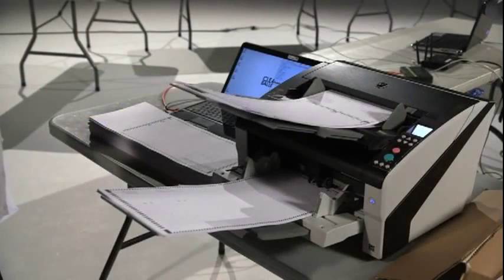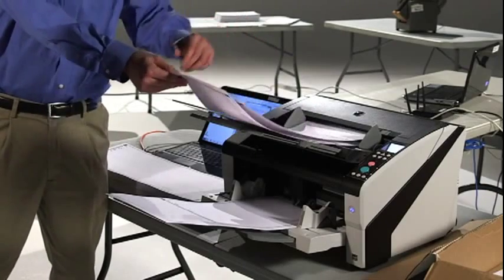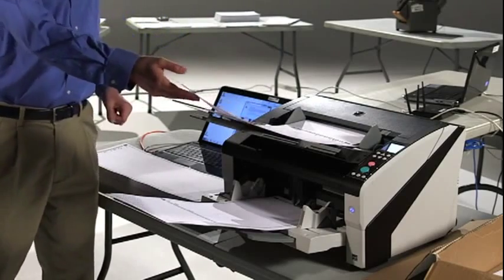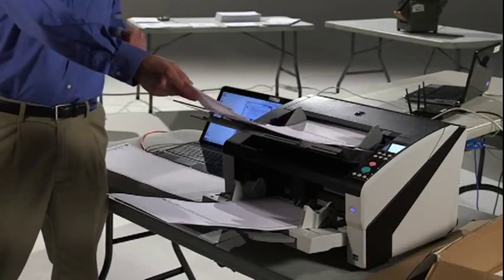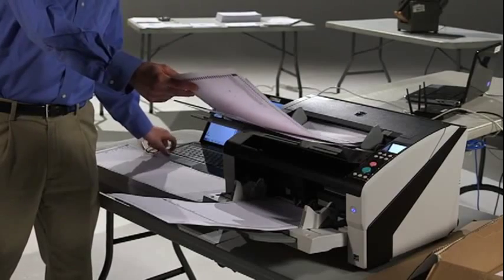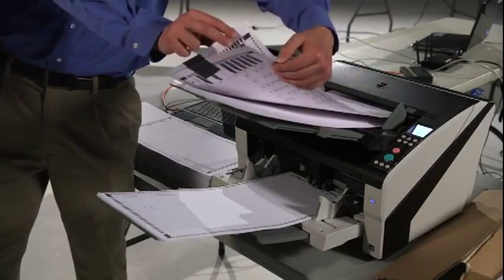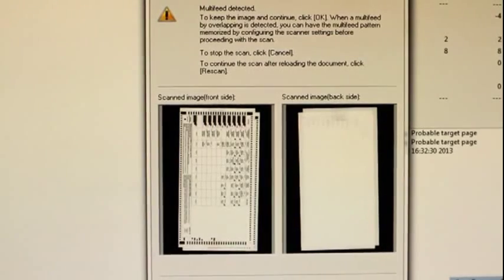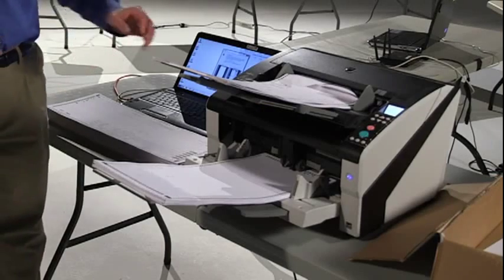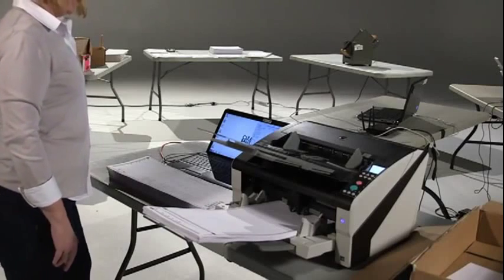On the 6800, multi-feeds are caused when the scanner detects multiple pieces of paper going through the scanner at once. When a multi-feed is detected, the scanner will display the two images captured for that scan and will trap the offending pieces of paper before they are fully ejected into the output tray. It is important to examine the images on the screen and the number of sheets captured at the top of the scanner to determine if a multi-feed occurred. If the images show multiple ballots, or if there is more than one page sticking out of the top of the scanner, those pages need to be rescanned. Gather the pages in question, click Rescan, and then reinsert those pages into the input tray.